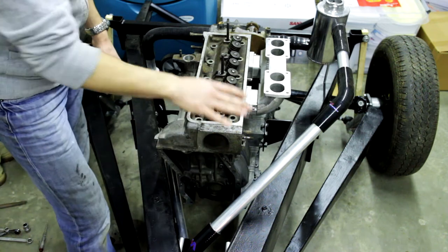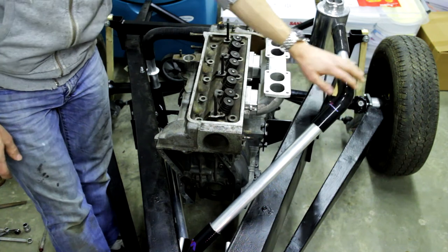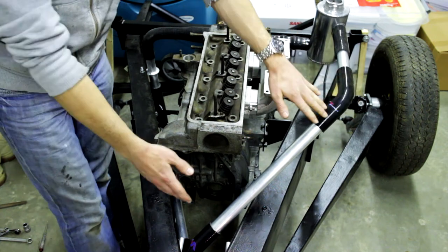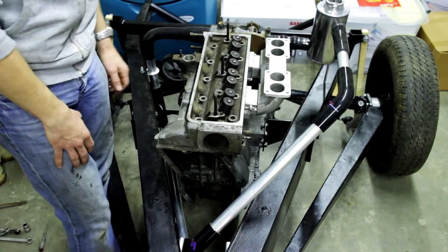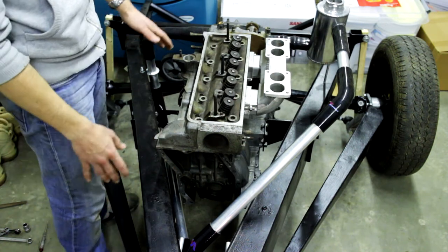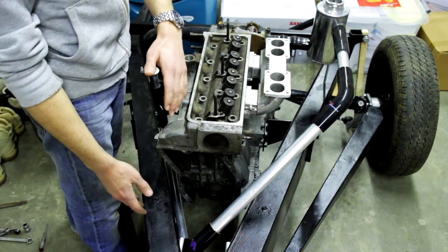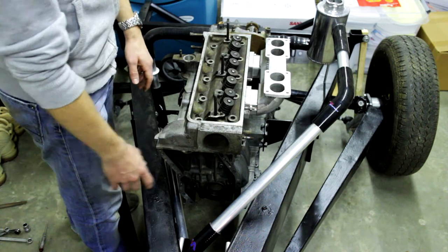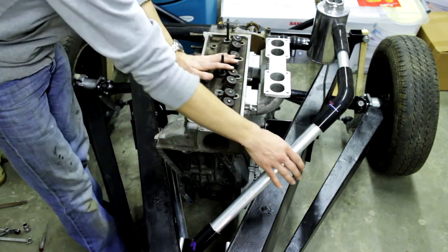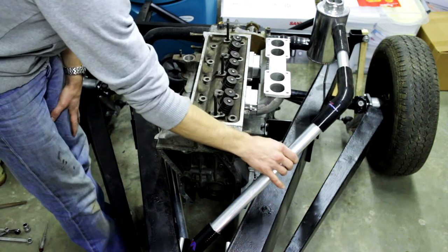From this point back it's a bit of a different story. I chose not to go with mandrel bends but with silicone hoses and short lengths of straight aluminium tubing — that was a bit easier. That also has some advantages: I can disassemble the rear cooling tubes if I need to, and I can make changes in the future. Another advantage is that this has a little bit of flex so the aluminium will not fatigue.